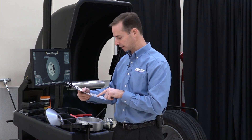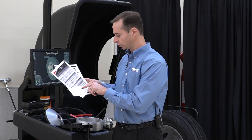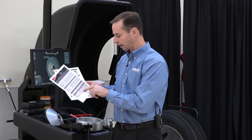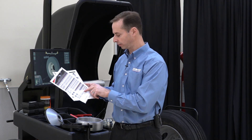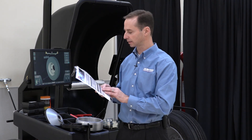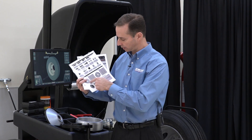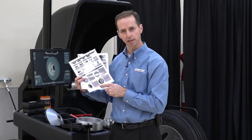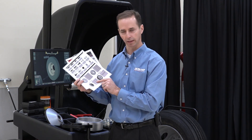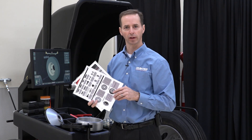For example, I've got a 4500 series Dodge Ram Dually, and that tells me I've got a 6.69 bore and a 10 by 225 millimeter bolt pattern — and in this case I'm going to need disc number 16. If we look on the back of the chart, you'll see the multi-step disc design. Disc number 16 is shown here and the part number is given, so that's how we can quickly get the right pieces. Now let's move over to the balancer and show you how it all goes together.